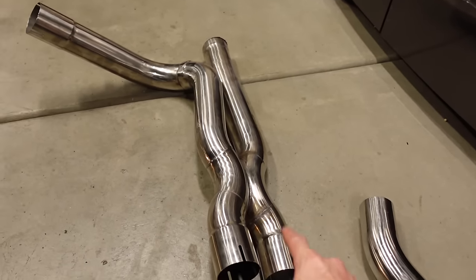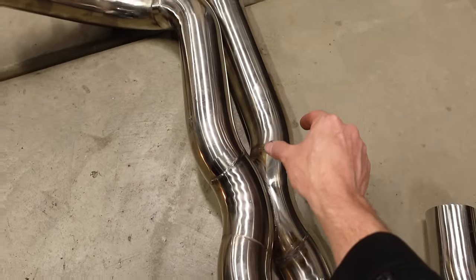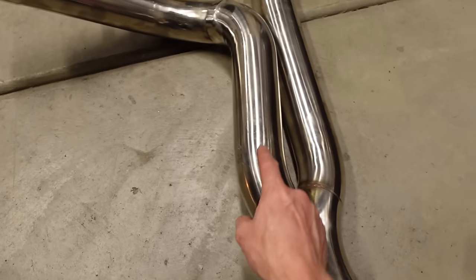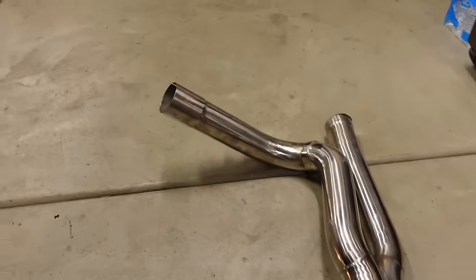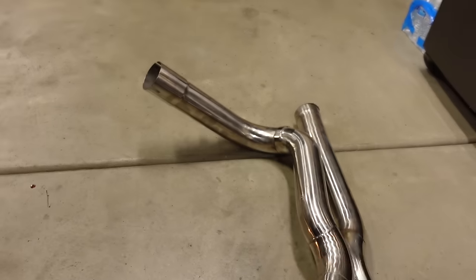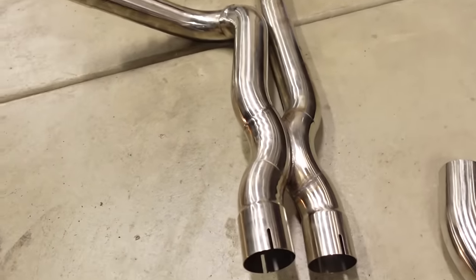Now, in theory, this will also produce more horsepower through the scavenging effect, which is basically where you have a pulse coming down this pipe and it crosses over. And because it's open in the middle, when it crosses here, it creates a bit of a vacuum on that bank right there. And so if it's timed properly and if there's an exhaust valve open, that vacuum will actually help suck some of the exhaust gas out of that cylinder. Now, in order to make that work properly, you have to have the lengths perfectly timed out. But most exhaust kits just have an X-pipe, and in theory, they've figured that out for you. So I don't know. But anyway, that's the theory behind an X-pipe,